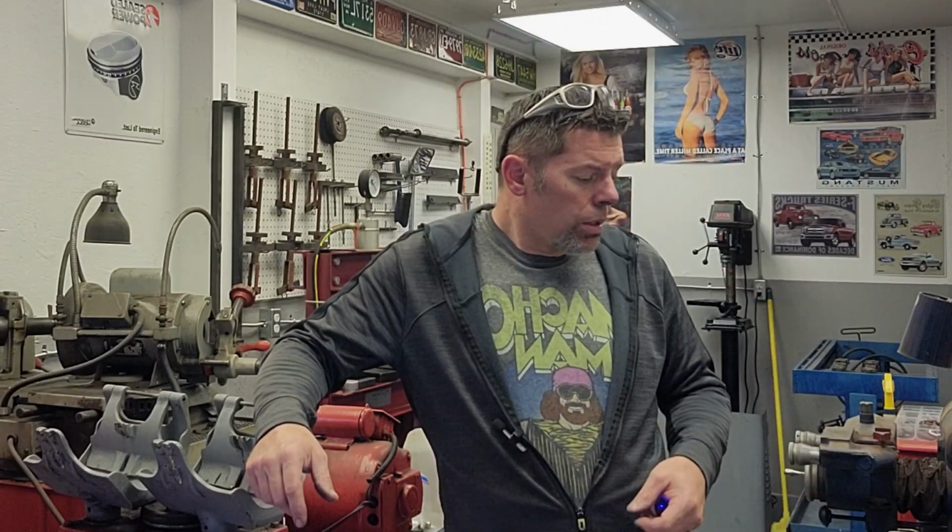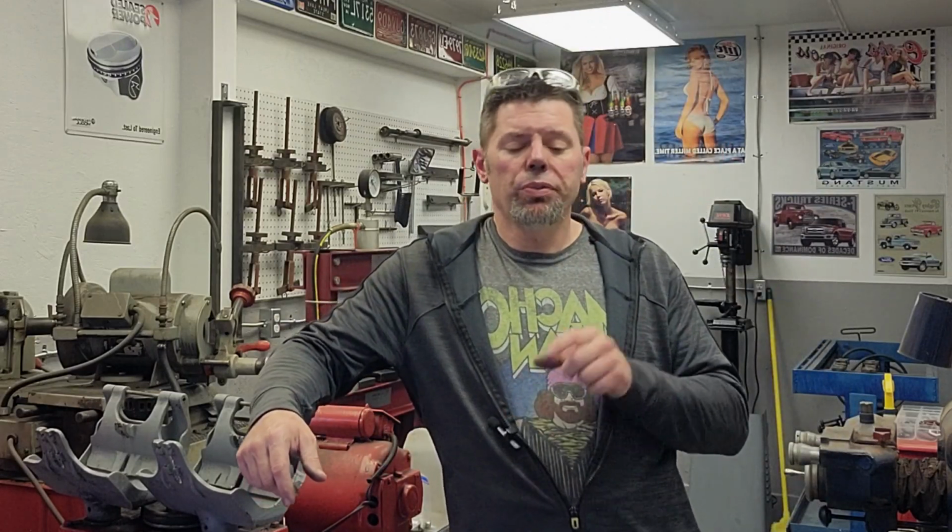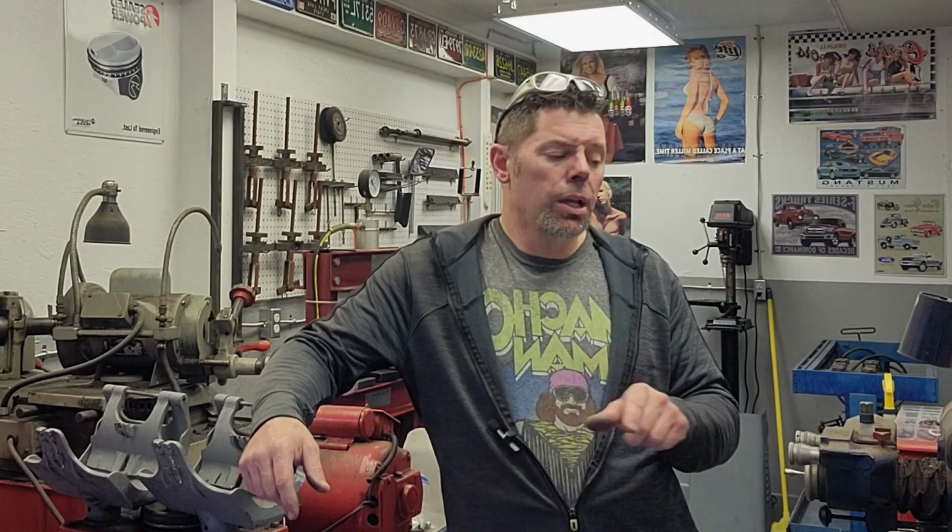So another question you might be asking, okay, if you're going to be using this tractor in a farm and field class, isn't this modification you've done on the cylinder head considered cheating? Well, remember, this tractor is a 1952, so this tractor is 70 years old. If we go back to maybe 1960 or something, we're doing tractor pulls, yes, I would say that would be cheating. Because you got to remember, I'm running a stock cam in this tractor. I'm not running oversized valves.